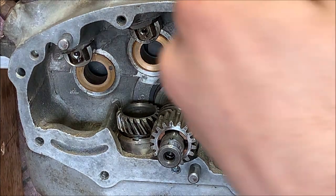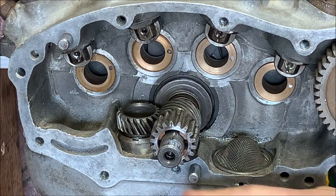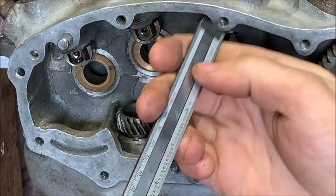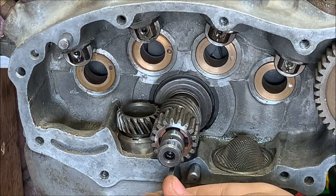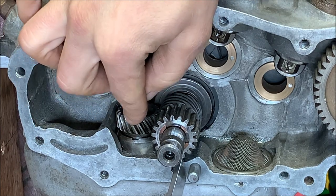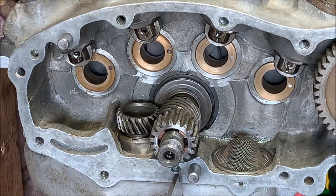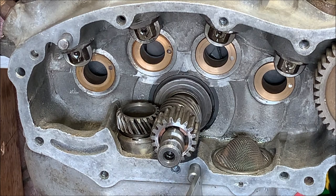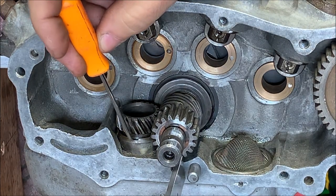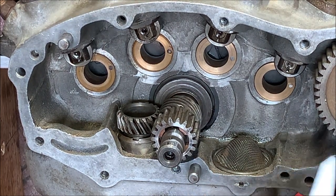You can take some calipers or a ruler or anything that you can at least get a good measurement with. And we want to put the face of this gear 5/16 off of the face here. So I got my calipers set and locked to 5/16. Push it in, and at this point we need the timing hole on the breather, which would be in, get a pointer, yep. Just missed it. At this point, we want the timing hole on the breather to be in this little slot cut out here. And it's not. So what we need to do is I need to pull this forward,